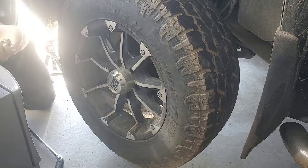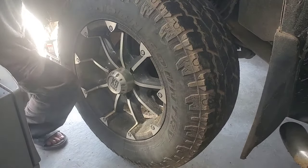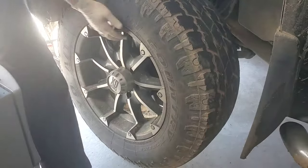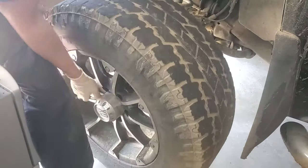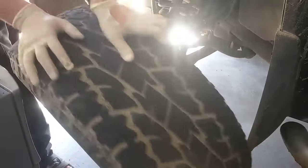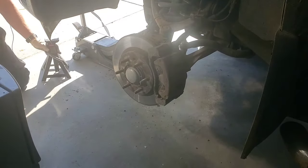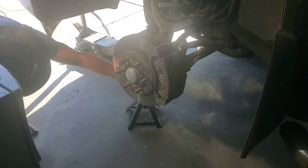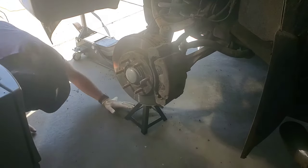Get the rest of these lug nuts out. Pay attention now — you're going to get a safety tip 101. Sandals. Nope. That's a bad idea. I've been doing that for years and haven't broken a toe yet. Count my blessings, I suppose. Get the tire out of the way and scoot back in here with the jack stand. Anywhere on that lower control arm area is going to work out just fine.